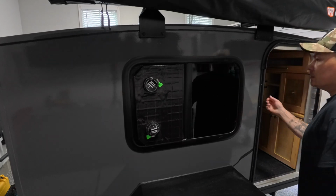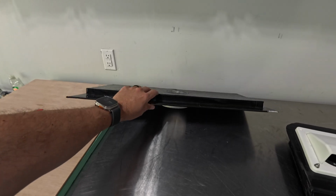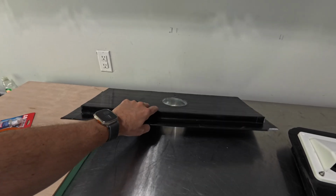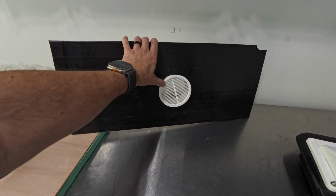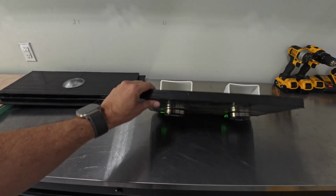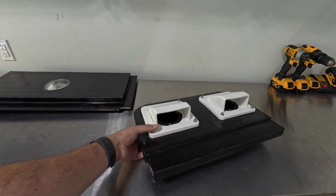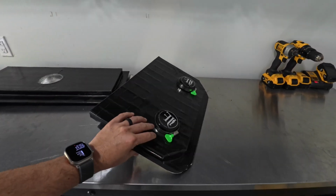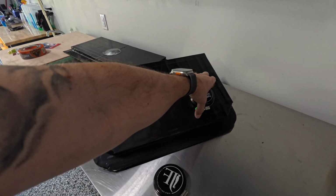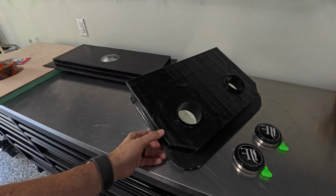Basically, it's an 1/8 of an inch wood paneling with about an inch thick of insulation with some sort of venting port to run the hoses. For the one on the camper, I've done the same thing using the same materials, except that I wanted to have this for my diesel heater, and I wanted to have a return so I could recirculate the air for extreme cold weather days.